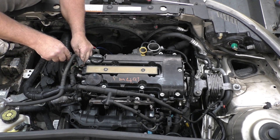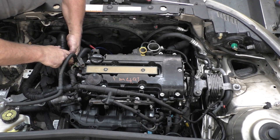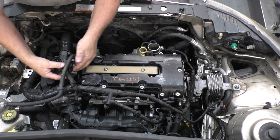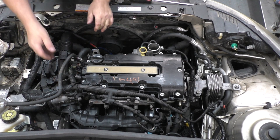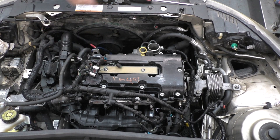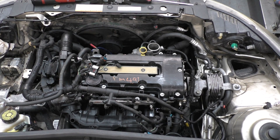All of this is undone. That one on the side — I hope the camera can see it — that one on the side is very important. That has to go right back on correctly later on. That is your ground. I can't stress that enough. That's a very important one to have back on there. That ground has got to go right back on. That is a Torx — I actually used an 8mm to get it off.